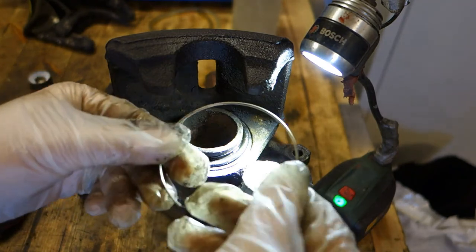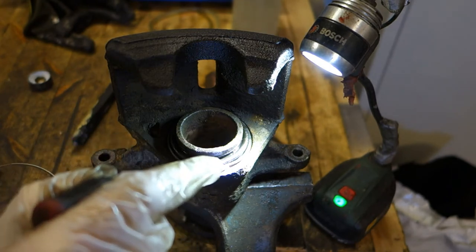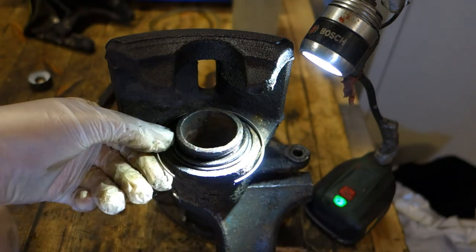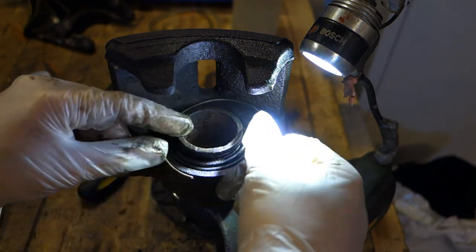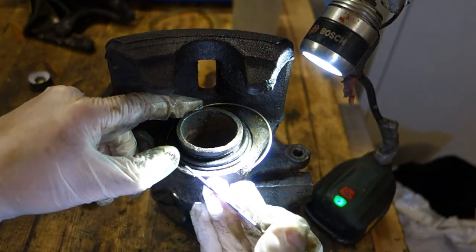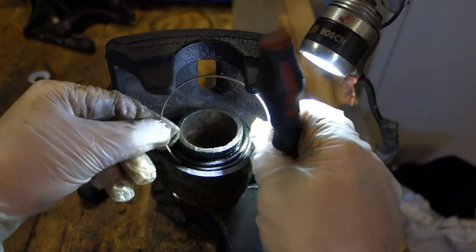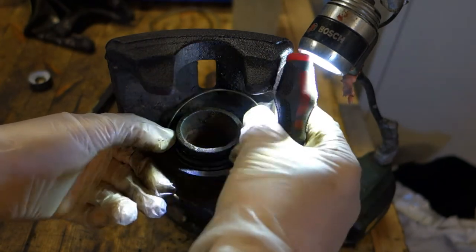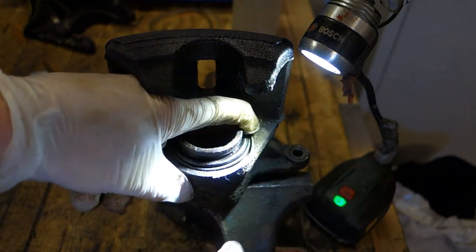And the final step is to insert that locking pin, and it goes in that hole in here. That hole between that and that, and it goes in, and it's good to start in one place, first this one end in here. Here it is good to also use this metallic spike carefully, so that we don't destroy this boot, but that we can insert that in there inside, like in that way. And then we start to rotate, and we compress that metallic pin a little bit. And then when it finally goes in there, we keep it in that position.